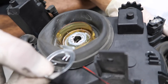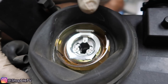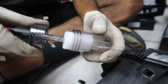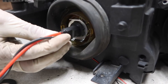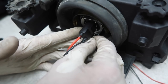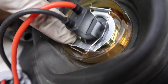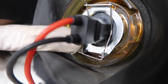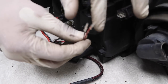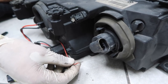Once the nut is tightened all the way, put the back section on and tighten the three Phillips screws. Then put the bulb in and secure it with the metal retaining clip — start from the bottom, get the two ends through the holes on top, then push the metal clip on the bottom through the holder and it'll snap right in place. With the solenoid, if you want to use the bi-xenon feature, they make a separate harness, or you can tap it into your high beam function — so whenever you push your high beams, the solenoid activates and removes the cutoff, giving you the full bi-xenon effect.